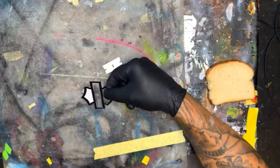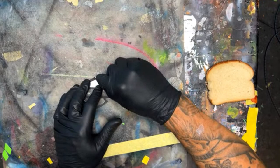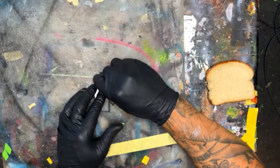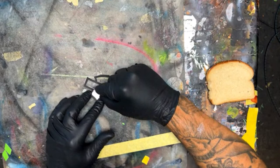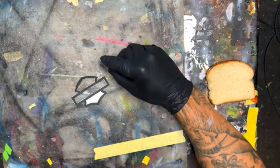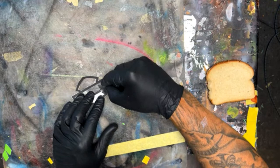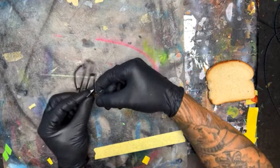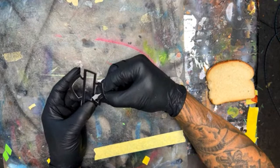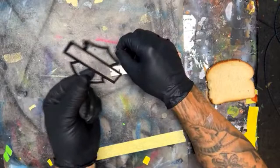Like I said, a lot of it's about the fundamentals, really. It's knowing how paint works, the process, different ways to get adhesion. And then after that, when it gets into custom paint, it's about breaking a lot of those rules, because we're doing a lot of different stuff. We're layering paint, creating paint edges. But you still need to know the fundamentals of how to lay out the primer, what kind of primer you should use, if it's bare metal or if it's been factory painted, the proper way to prep that part, the different spray guns, and then the different types of custom painting. We'll get into the realistic fire, because, man, I'm telling you, that will still pay the bills. If you can create stencils like this, or a skull stencil. Here's another one right here.